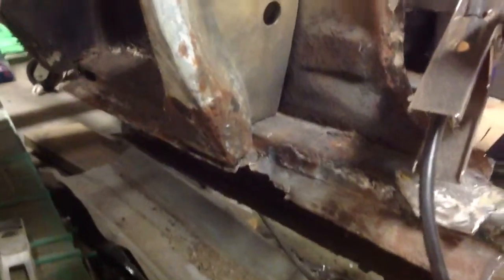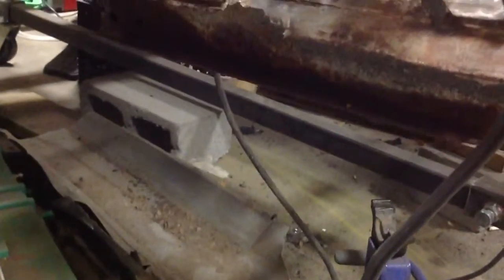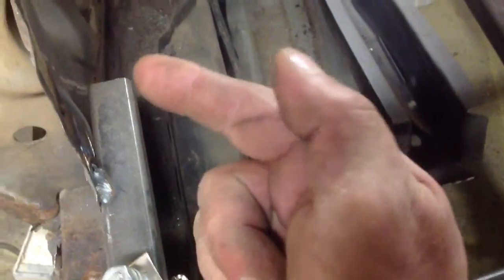Before I tack that, I'm gonna come over here. As you can see, this is just a nightmare over here — that's part of the outer rocker, I still got to detach that. And then inside the car, that part right there is all the inner rocker and I've already cut it off at the plasma cutter, so I just got to cut the spot welds attached to that part, make my marks and measurements to make sure when I put that inner rocker back in it's in the exact same spot.